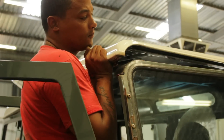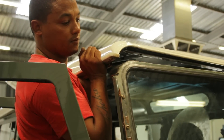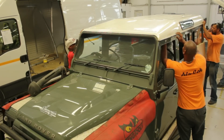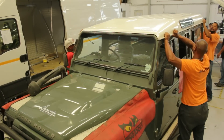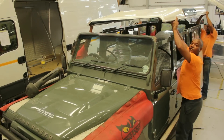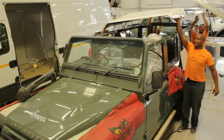Once the glue line is cut, you will need to lever and force the roof to lift away from the last part of binding glue. Then, with the help of others or using a forklift, you may be able to strap and lift the entire roof off the vehicle. Part 1 of the job is now complete.